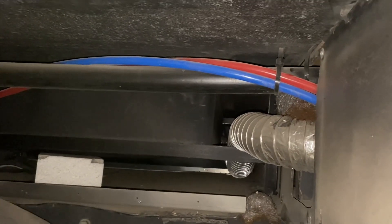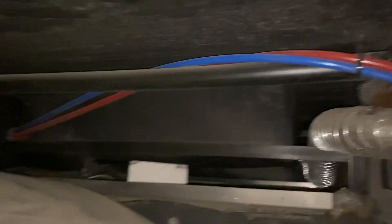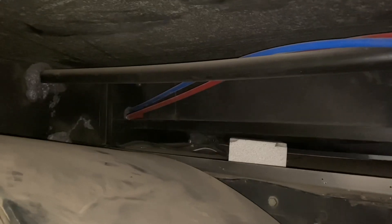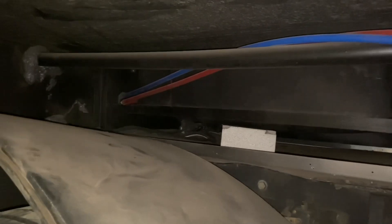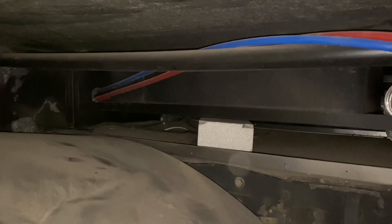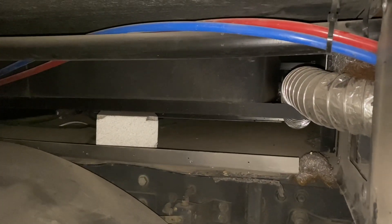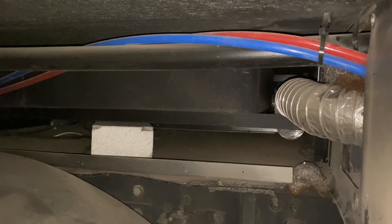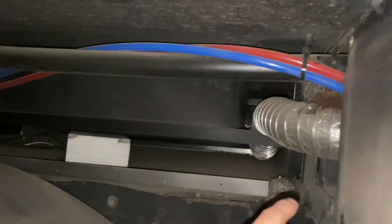You also have a two-inch gray line there - that's a plumb drain going this way over the gray tank. You can see there are gaps over there. They did attempt to fill that with foam but it did not adequately work. There's no insulation around the actual black tank at all. There is vent work coming through, so if you're running your propane heater you'd get some heat around the black tank, but not adequate enough for the type of winter camping we're going to be doing.